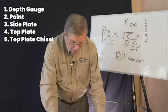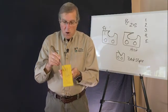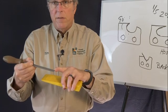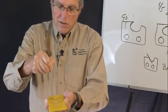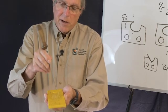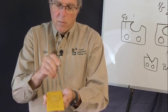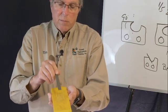Now, let's look at an illustration. Let's say this is a block of wood and we're going to chisel out an opening here to install, say, a hinge. I take a flat chisel, which would have a beveled edge on it. I have a point here, a point here. I could even mark it for 1/4 inch deep. Then I drive that point in with the bevel to the inside. I drive this in and I do several verticals here that make this long area. Then I go over the width of my hinge or whatever. I turn the chisel over and do the same thing on this side. So I've created 2 verticals, and both of them are the width of the chip I want to take out. Now I take that chisel and chisel out between the 2 verticals.